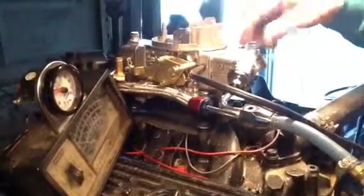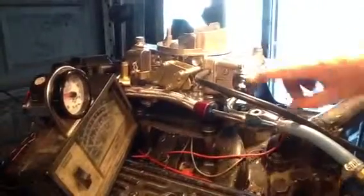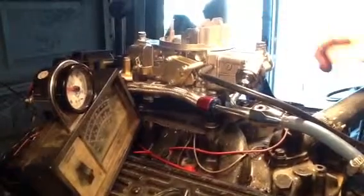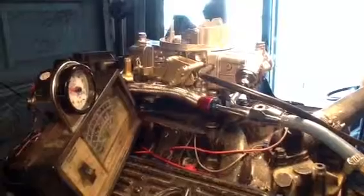There's your fuel adjustments right here, and you've got a little thing here. You're not supposed to monkey with them, but if you ever have to, you turn that up and down until the gas just barely dribbles out of there, then you tighten them back up. A lot of people do it while it's running. There you go — go buy it.